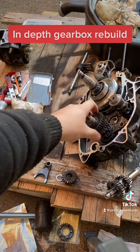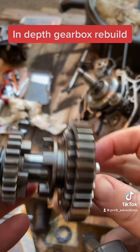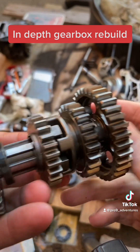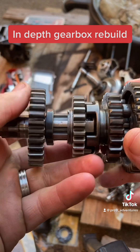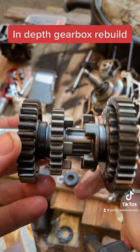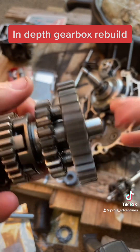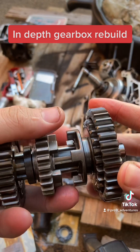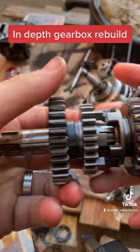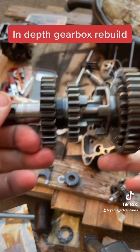If I just remove the countershaft — it is this middle sprocket here which has the different gearing. If you haven't seen a gearbox before: the phrase 'shifting gears' literally means that fork that slides in here as you shift changes, so things can move either separately or together to put different gears in contact with each other across two shafts. In the grom this is a four-speed box.